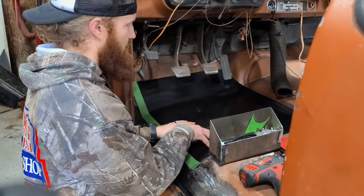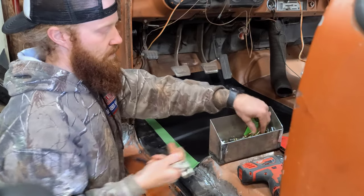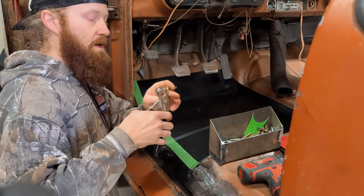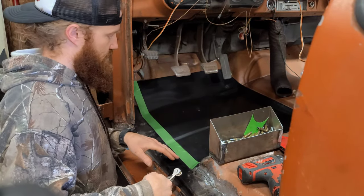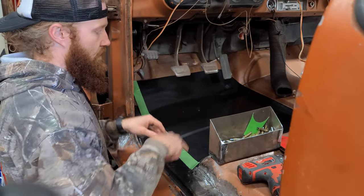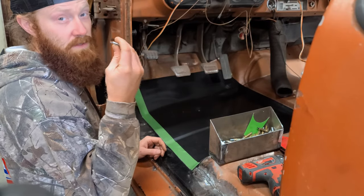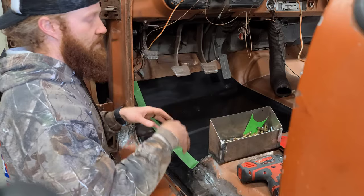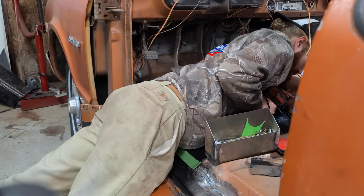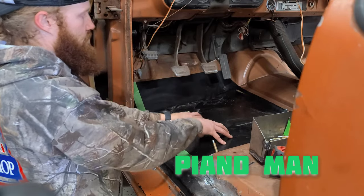Now that the panel is fitting much better with that lip removed, I'm going to drill a couple holes around the panel perimeter so I can put some clecos in. A cleco works by pushing down on it to contract it, then pushing it through a hole — it holds your panel in place bonded to the metal underneath. I'm going to drill holes and throw clecos in so when I cut the perimeter the panel is locked down and won't move around. If you don't have clecos, self-tapping screws work too — I've done that plenty of times and they also help pull the panel into position.